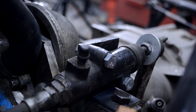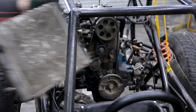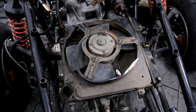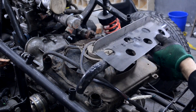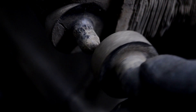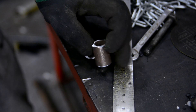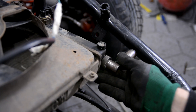The next element to install is the cooling radiator. It's in bad condition but it doesn't seep, so there's no need for replacement. The only suitable place is over the gearbox under the passenger's steps. I'll fix it through rubber spacers as it was in the original car, cutting fastenings from pipe for them. After fitting I welded them to the frame.